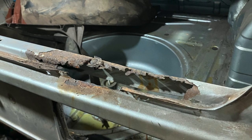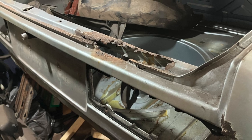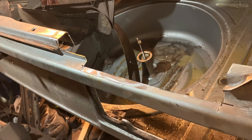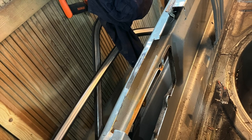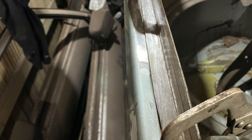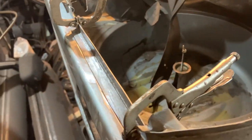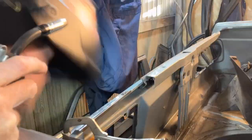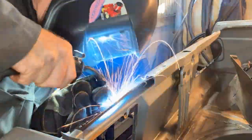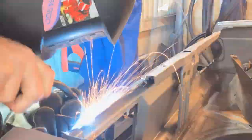Back on rust repairs on the E30. I wasn't looking forward to doing this bit — just above the rear lights where the boot closes. It had a few different bends so I didn't want to cut it all out, but it was pretty straightforward. I cleaned it all up with a wire wheel and sanding pad, got back to where there was no rust, and took it in sections. The first section was just a bit of steel L bracket I had lying about — I had to trim it down both ways and cut the new steel to match the existing bodywork.